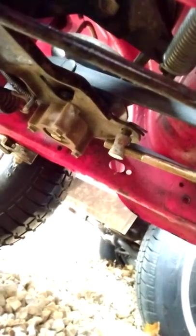There we go. So that right there is your variable speed pulley. Basically, it varies the belt ratios. That way you get different speeds. But the problem with it is when I have it in 7th gear, it's all fine going down a hill. But as soon as I'm going up a hill and it becomes under load...